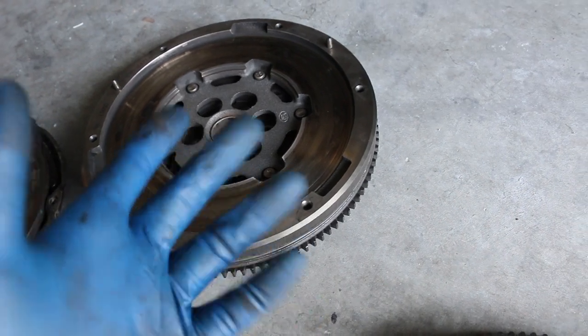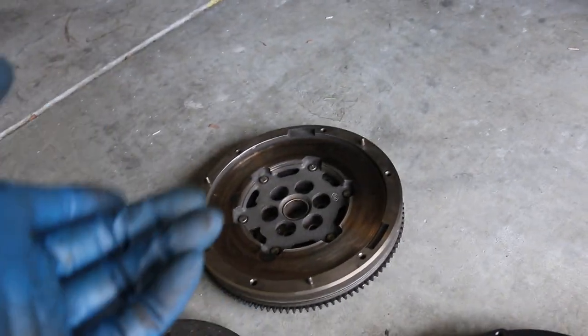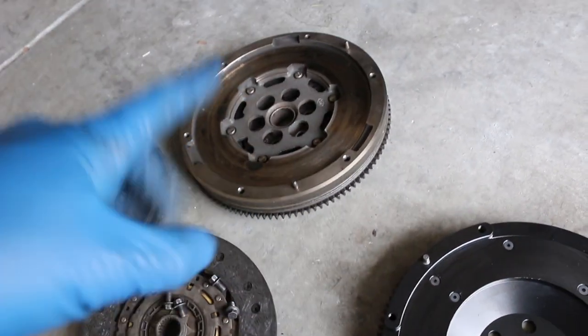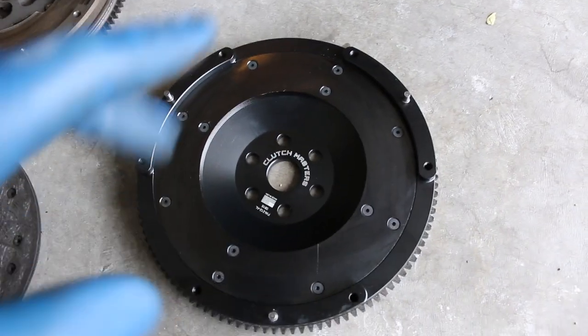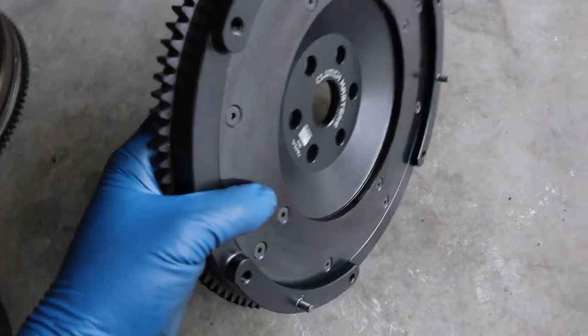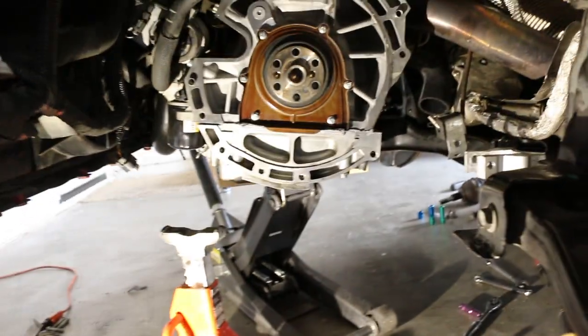For the most part it's going to be substantially different drivability-wise, and it's going to rev up a little bit quicker because the flywheel is a lot lighter. I'm going to start getting this on. The flywheel is torqued down, I got the bolts in with some Loctite. For the clutch — in the box the actual clutch alignment tool was missing for this specific clutch, but I did have an extra one from another clutch I did before. The splines do match up, but the tip isn't quite as wide as the inside of the crank where the alignment tool goes, where usually the pilot bearing sits.